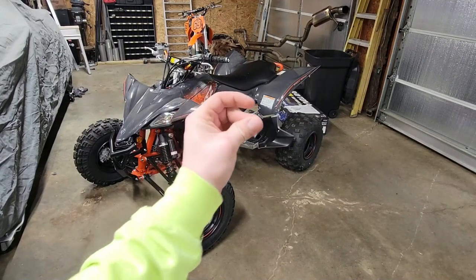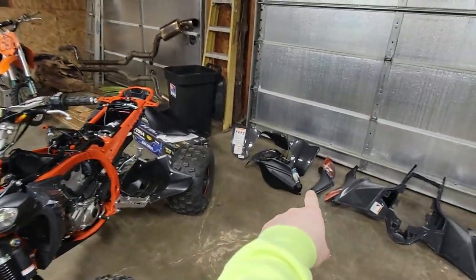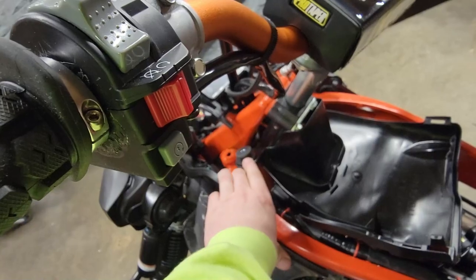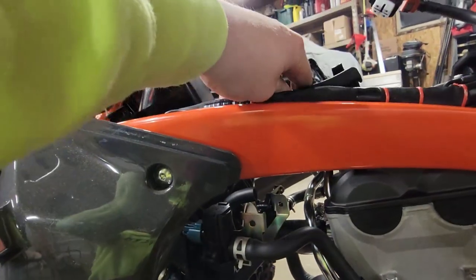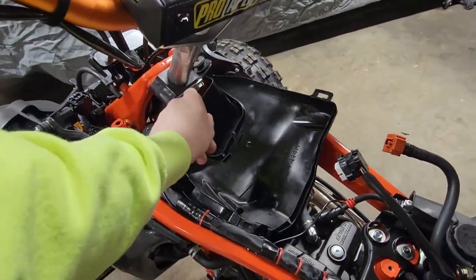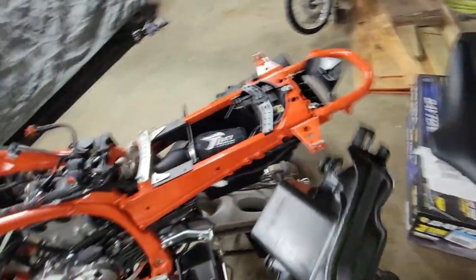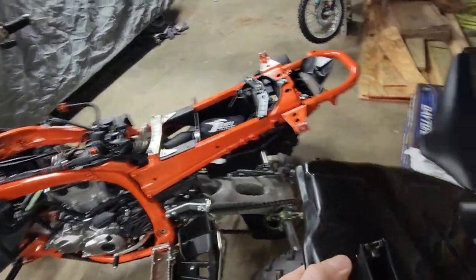We're going to start by taking all the plastics off. Plastics are off. Once you get your plastics off, you're going to also remove the fuel tank and then you're going to remove this plastic tray. To remove the plastic tray, the two little bungs that the gas tank hooks onto — remove both bolts there. Under here you'll have this thing here, and this tray will actually sit down in here farther. You remove a bolt here and on the other side, then you get a little finagling to get this out. There's actually a hose that hooks onto there — I think it's for the gas drain, so if the gas tank were to leak it runs out underneath.